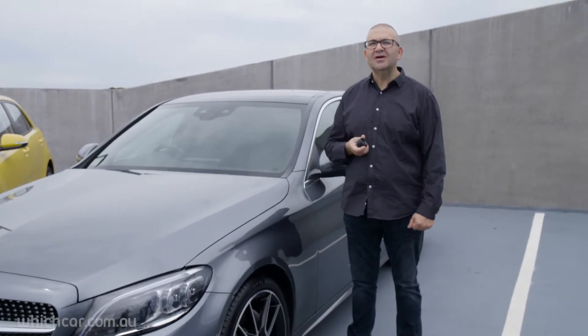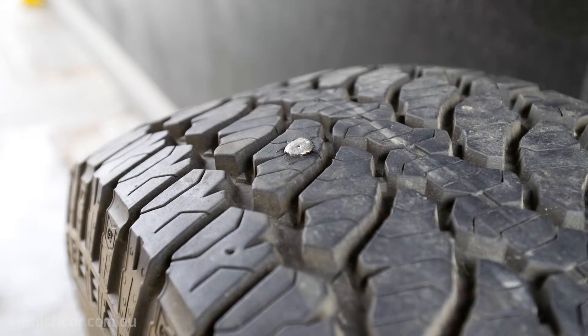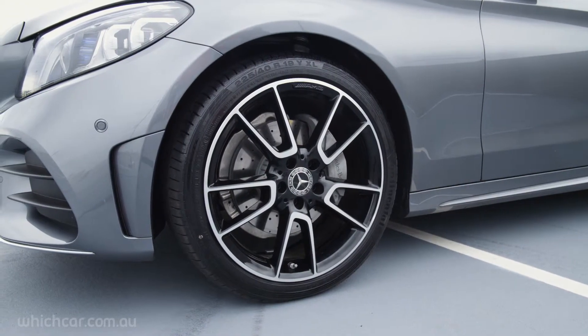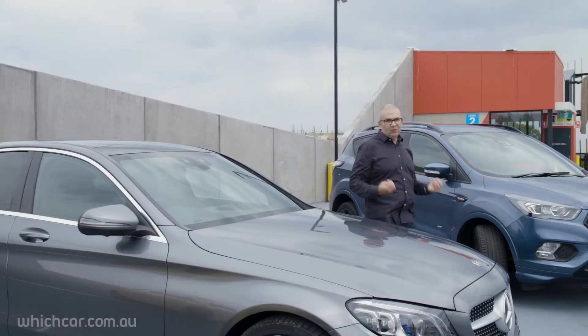So how often should you check your tire pressure? Every time you fill up would be ideal, but try for at least once a month. Regular checks could also reveal a slow leak from an embedded object like a nail, which means you can fix the problem before it leaves you stranded. It's good to check pressures before you drive too, as the air inside hasn't had a chance to heat up and expand, which would give you a higher pressure reading.